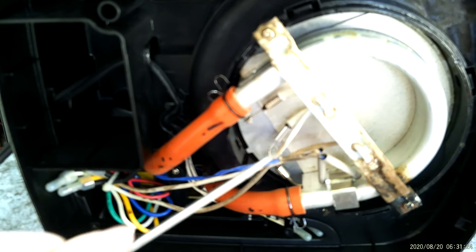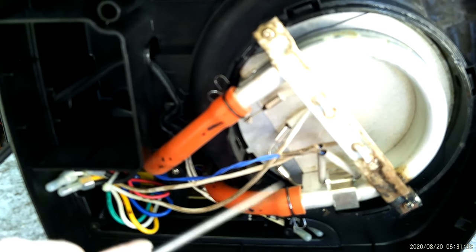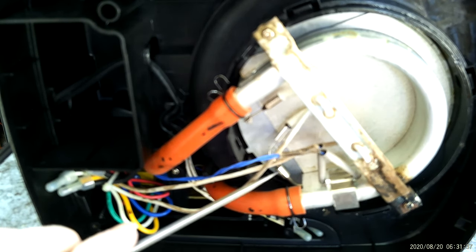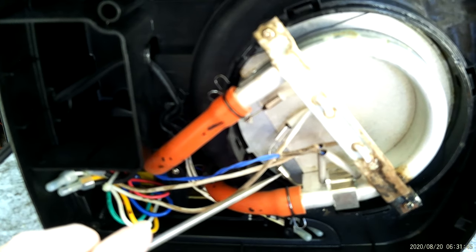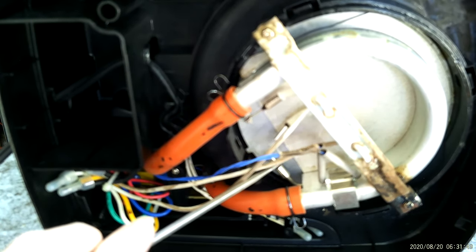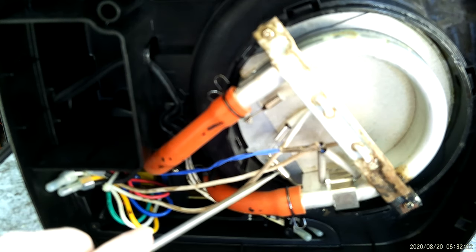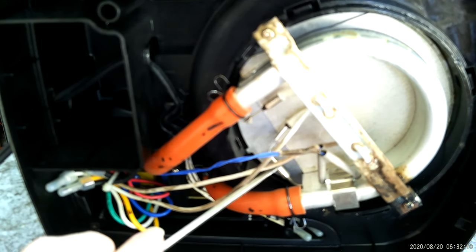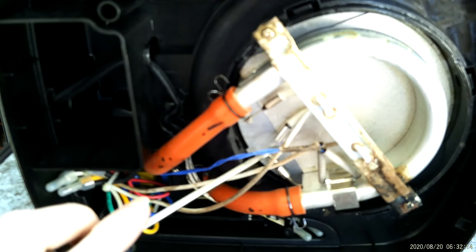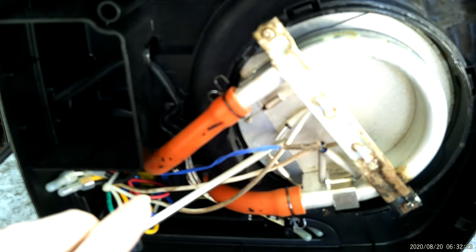I wanted to use copper connectors, not aluminum ones. I was afraid it might try to melt an aluminum connector. I found one that was small on one end and bigger on the other, so it stays taut and won't fall off. I tried two others and the tail broke — I had it all hooked up to one end, but with moving it around so much it broke. They will break pretty easily. There was still enough left to get it crimped in. So I've got it crimped on. Also, if you use a soldering iron and yours isn't very hot — like mine, they're old and not very hot — by the time you heat the whole thing up, you're liable to blow that fuse.